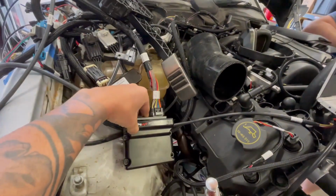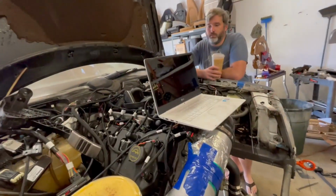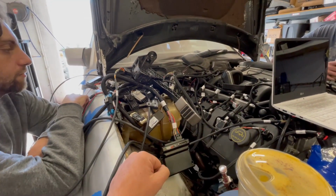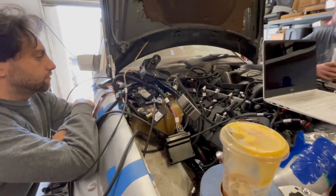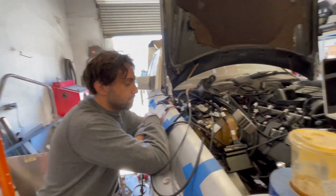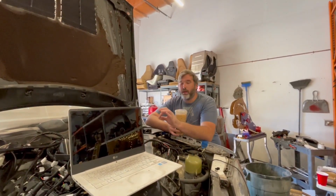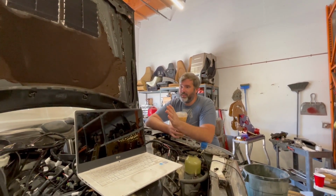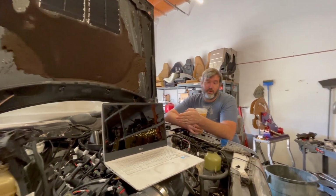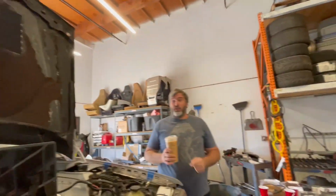Alright guys, you'll notice it's a new day, probably based on the change in lighting. There are probably several things I could fault about the Terminator system, but it is very difficult to integrate new tunes and laptops. They don't provide you with the cables or thumb drives that you need, and the SD card system kind of sucks. Most ECUs have an easy way to plug a micro USB into the computer. You have to buy a $50 cable from Holley to do that. Luckily, Sam's ruined another car, so we've got this. That cable costs $50, and that's a travesty.